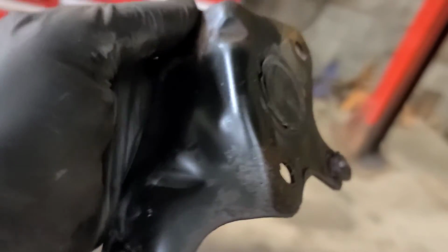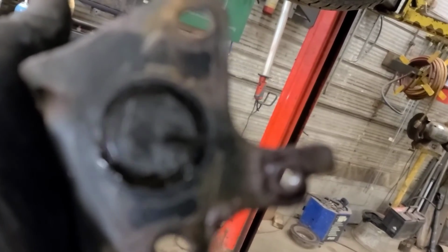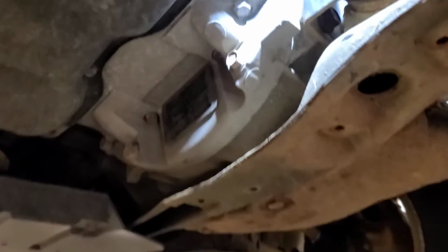So this little brace at the back of the intake manifold here actually has a hole in the manifold. You can see the orange O-ring there. Try and move this hose out of the way. So make sure that O-ring's in place. There's a little ear on it to locate it. I'm going to clean this off and reinstall it on the back of the intake. Must be for an EGR or something on some models.